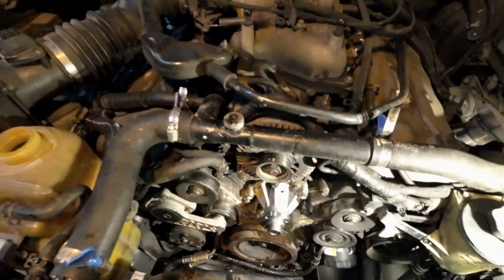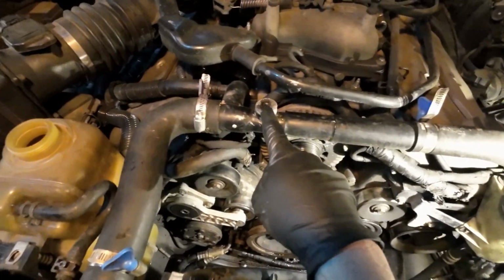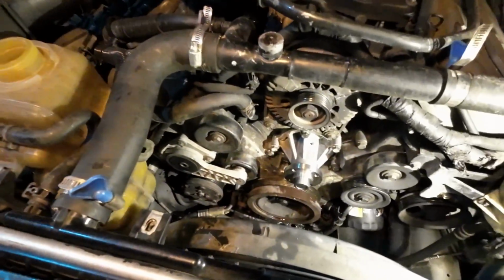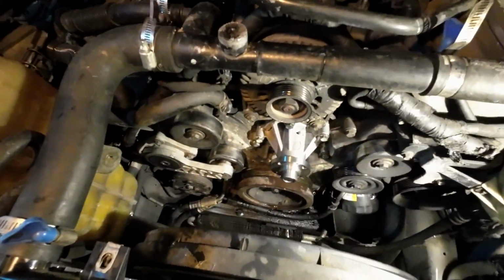All right, now that the water pump is reinstalled, before reassembling the entire serpentine belt and shroud and fan and everything, I have closed the crossover fill tube with the crossover fill tube plug. I reattached the upper radiator hose and the tube to the degas bottle because this is a great time to test the pressure in the system before reassembling everything.